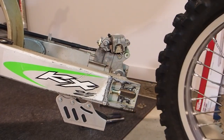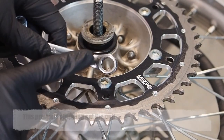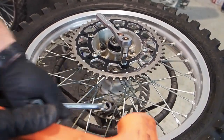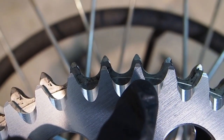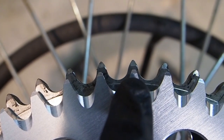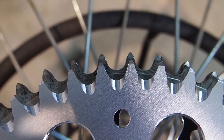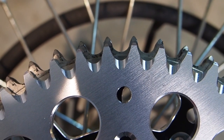I've got the tire removed from the bike and up on my tire stand. Not much to be said about taking the rear sprocket off except to use the box end side of the wrench when taking those nuts off — you might even have to use a dead blow hammer to knock a nut free. The sprocket that was on it really wasn't in bad shape. You can tell if it's in bad shape if the teeth are more cupped out; the tip of the new sprocket is flat at the top where the old one is a little more peaked. I just like the color of the new sprocket and having all the same brand to complete the set.